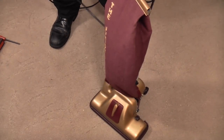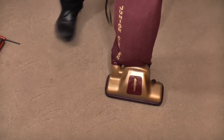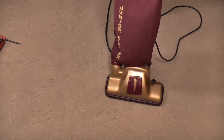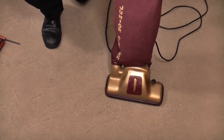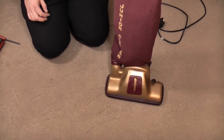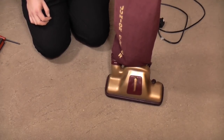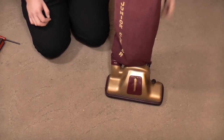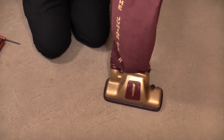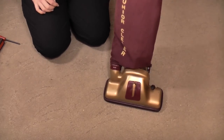That's a four out of ten unfortunately. The belt isn't correct — it is slipping sadly. But if you can find the belt from factory... I got the entire box of belts out and that was the best one that fitted. The Kirby belt is too big. Obviously the belt it had was so tight it would have wrecked the brush roll bearings and the motor bearings, so that went straight away. But it did okay — it's more of a looker than a let's-clean-an-entire-house. And what a looker it is — even the bag's staying fluffed out.